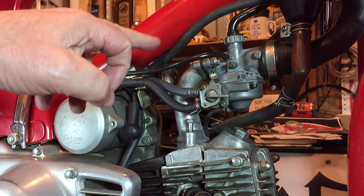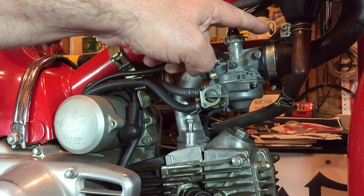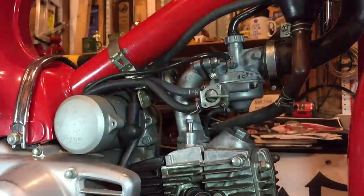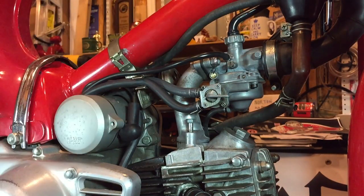And it does. What I did was I took this hose off here and removed the boot — the clip first of course — and then looked inside here just from this side, just to see if the piston was bottoming out, and it was. I've also been up to the handlebar and checked the slackness or tightness of the throttle cable, and everything seems to be working just fine.